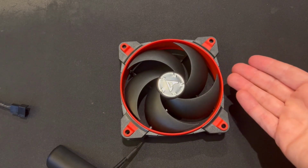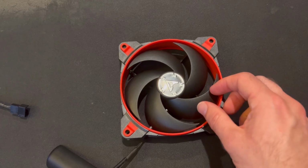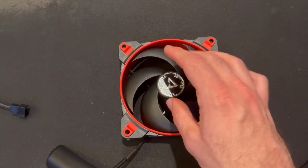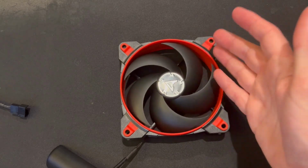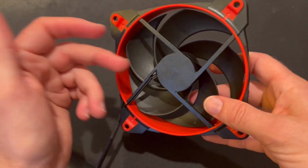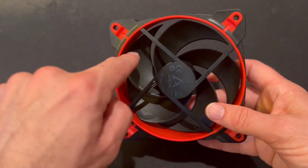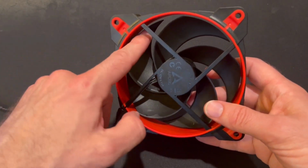So that drives up the cost to have the better, more expensive material, because cheaper materials will tend to stretch over time, and when the fan blades stretch, they'll eventually hit the housing and either cause the fan to no longer spin or make a horrible racket as the blades are hitting the edge of the frame. But the cup design of it, again, helps accelerate the air out the back, and it's a steeper cup as you're inside, as opposed to the outside. And that's just to help the inside accelerate more air through it.